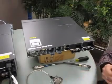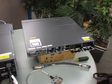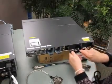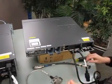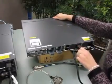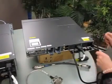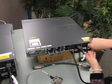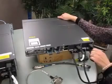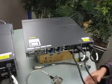Using your slotted power cords, what we do is there's a little funny twist that you have to put into them to actually get them into the cable management for the power supply. You kind of round them out a bit. The power supply is fitted and it pushes in place like that. Make sure it's secure. We'll put the second one in place the same way. Put a little twist in there so it doesn't fall out and connect it in. So both your power supplies are connected right now, but do not plug them in just yet into a power source. We have to finish setting up the stack before you can do that.